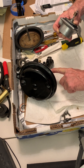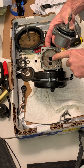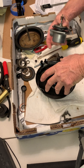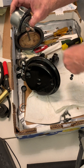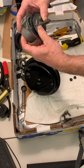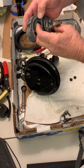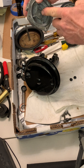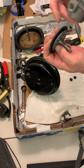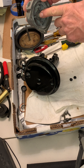Then what happens when you put your foot on the brake? Pressure goes in here, and the pressurized fluid tries to come up out of this thing. The thing that's stopping it is this piston, which has rubber seals on it. The rubber seals keep the fluid from coming out, but because they're trapping the fluid, it pushes that piston upwards, which makes this go backwards. When this goes backwards, it closes this port here against this surface, so the vacuum that used to get pulled through that hole is now sealed off.